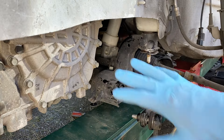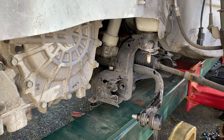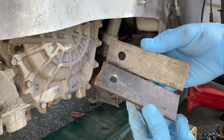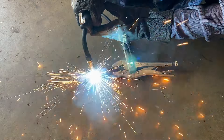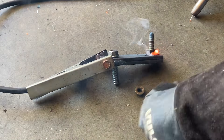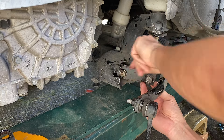That's where it's supposed to be. There's obviously more than one way to go about this, but the solution I came up with is to use this sacrificial bolt — it's actually quite a bit shorter than the bolt that's supposed to be in there. Since I didn't have any thicker metal plate, I ended up doubling up some of the thinner plate I had on hand. I got both plates welded together and welded one more bolt to the other end of the plate. Next, this contraption got screwed into the subframe.